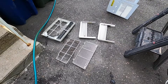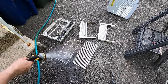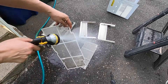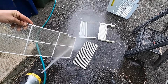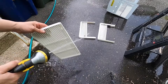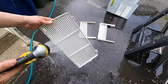I've got all my pieces sprayed. Now I'm just going to let that soak for a little bit. For the really dirty stuff you can use a brush — that just looks way better already. Just be careful around the sensor here for the thermostat. I might even spray that down again. After you spray everything down and scrub it with your brush, now comes the fun part — spray it down with your hose. You want to make sure you rinse this stuff off really good, get all the bleach and soap off of it. It's good to do this on a nice warm day where you can just let the stuff dry out for quite a bit, especially the unit itself.